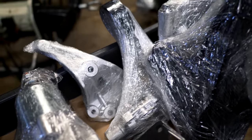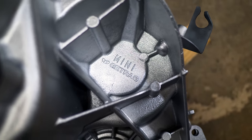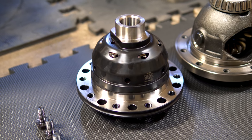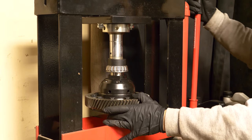And I did the same kind of treatment here to the transmission. So last week and a little bit before Christmas, I was really busy with this thing. So I put a new limited slip differential inside the transmission. I put new seals, I put new bearings inside this thing, and it looks and is going to behave amazingly,